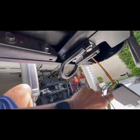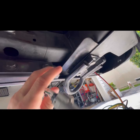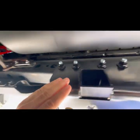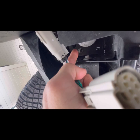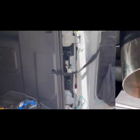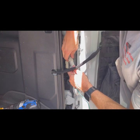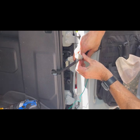On the driver's side we've got everything coming down below. I want to take the green wire and this connector and feed it along here, tucking it up and out of the way to keep it out of the elements, then feed it back up through here so we can connect to the passenger tail light. I'm just going to bring this green wire and connect this to here, then connect this one.